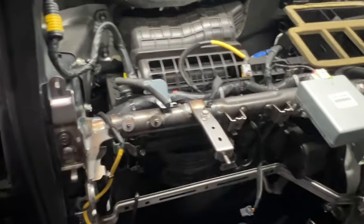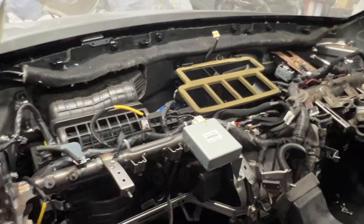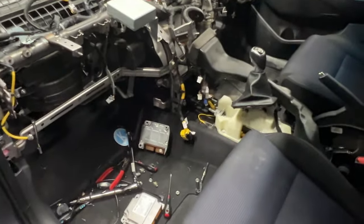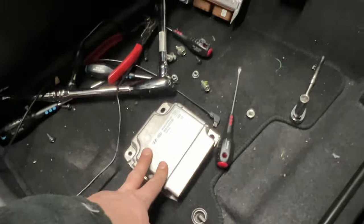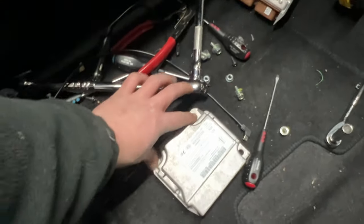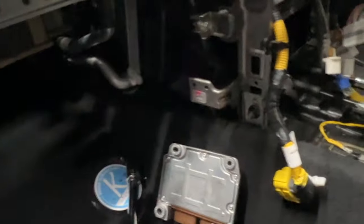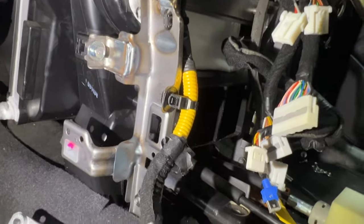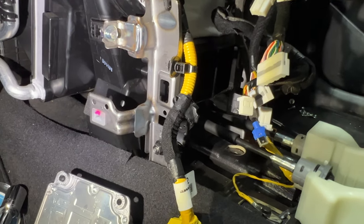And there we have it — one dashboard fully removed. There was one trim clip I forgot to remove on the passenger side just here. That's why, when all the bolts are undone, don't just rip out the dashboard — just slowly pull it and you'll be able to feel if there's any resistance from anywhere. The hardest job was the SRS module — that's the original one, the replacement's just here. There's a 10mm bolt closest to you and the two at the back are 10mm nuts. I had to use a quarter-inch ratchet with a long 10mm extension because there are two studs at the back that need a long deep 10mm socket. Quite a pain to do, but apart from that the dash was quite simple to remove.